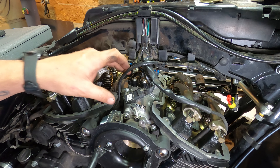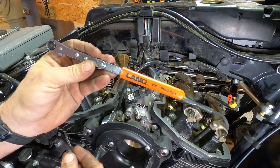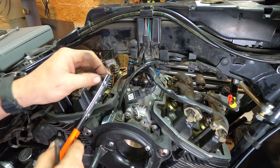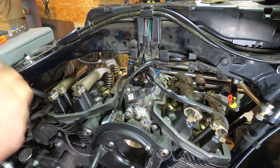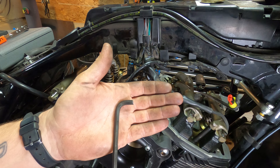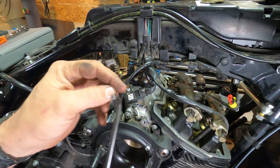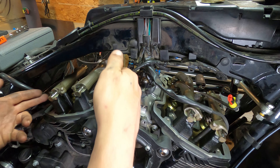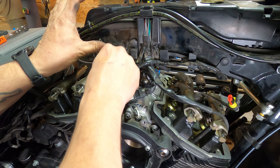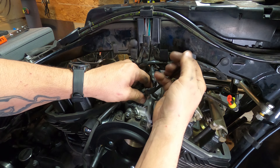I'm super unhappy with this Lang 5530 because the bit keeps falling out and I can't get it in there — I think it's because this intake is that much bigger. So I made my own intake wrench. If you're going to do this, I recommend using a cheap one from the store instead of your good set. I cut about a quarter inch off the end and tapered it so it's smooth, making it easier to tighten the intake. Since the valve cover may block the next flat and I already ran into the frame, this just makes it so much easier. I don't know the torque spec on these and I'm not sure you can even get a torque wrench in here — we're just going to tighten them until they feel tight enough.